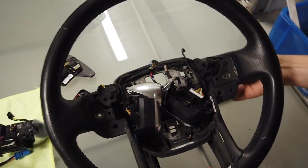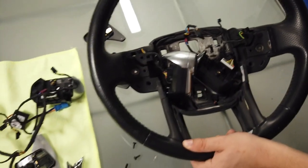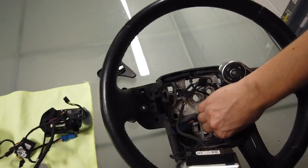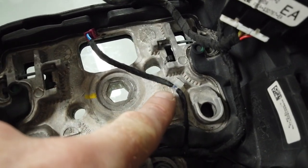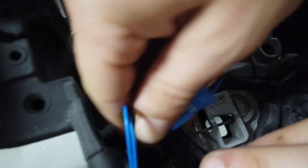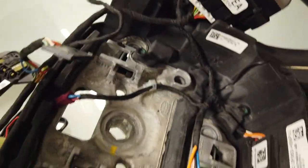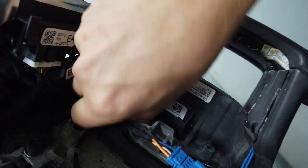The main loom tucks in at the back at the top — just have a quick look before you take it out at how it dresses in, then the whole switch pack assembly should come out. There's a connector we can push out from the rear, and also the heating plug and heating module which nest in. Get that blue heating connector out first — there's no clips on it, just pull it apart. Then wiggle that module out of its little pocket in the rubber.